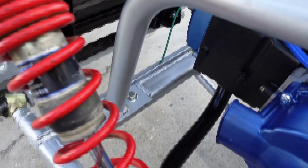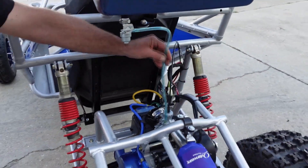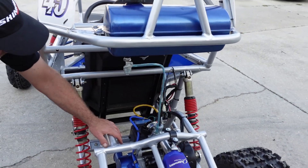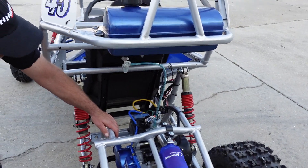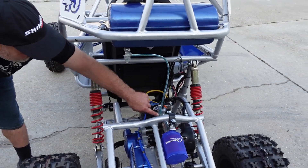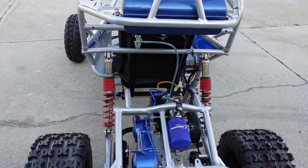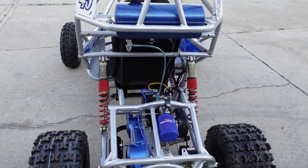The fuel tank and petcock - I like to put enough fuel line so that as this thing's bouncing up and down there's slack. At our first MBX races, a couple of racers went over a jump, the thing overextended and yanked the fuel line right out of the carburetor. So we learned that a little extra fuel line does not hurt.